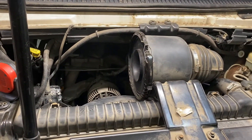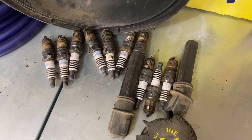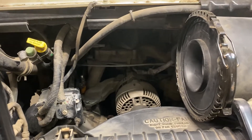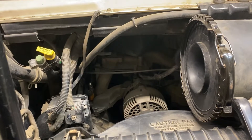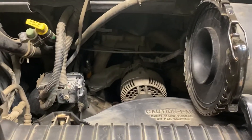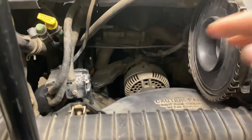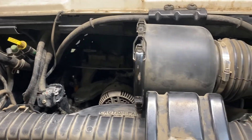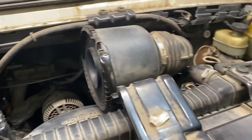It literally scraped rubber across the top getting in. Today I'm going to show you spark plugs — removing and changing those out. I got the job done already but I want to go over some things to help you guys out. I've actually changed one of these V10s in a bus, which is very similar from the dash back. You have to remove the intake, we had to make a special plate — just not a fun vehicle to work on whatsoever.